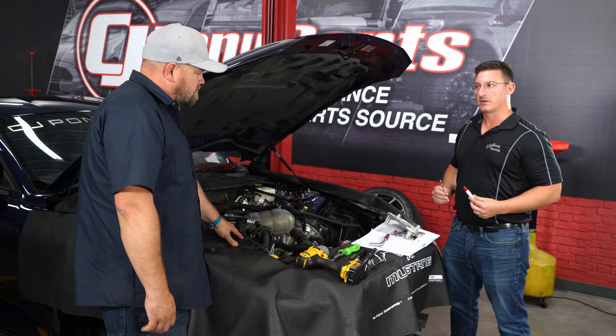Next, pre-fill the intercooler tank very slowly, then give it power to prime the pump. Don't forget to reconnect the EVAP solenoid connector. Key on the power — the pump will draw down the coolant, and it's helpful to have someone pouring coolant as the pump draws. Once the coolant tank is full, let it run for a couple of minutes to purge all the air, then install the cap — don't over-tighten it. Finally, install the included rubber hose protector over the fuel line to prevent it from rubbing against the side cover as the engine moves; secure it with electrical tape or zip ties.